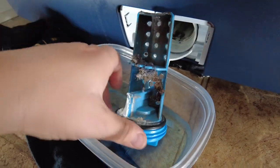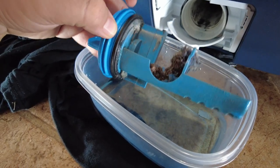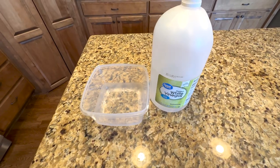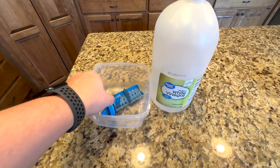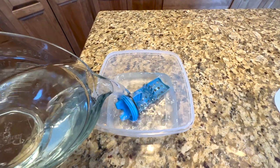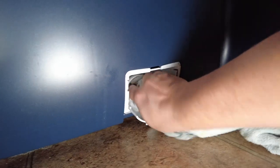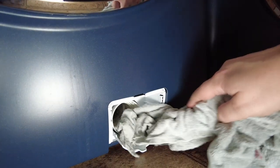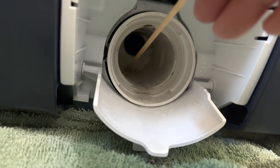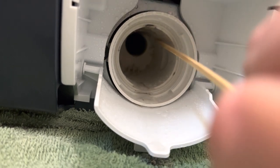After the water drained out, we cleaned out the filter by removing all the big debris and particles, then rinsed the filter under warm water to get the rest. To disinfect the filter, we soaked it in a solution of one part white vinegar and one part water for about 15 to 20 minutes. This helped kill any leftover bacteria or mold on the filter itself. While the filter was soaking, we used some old towels to wipe the inside of the drain pump cavity, and we also used wooden skewers to help scrape off buildup in the corners that was hard to reach with just a towel.